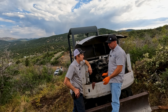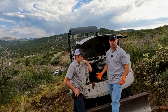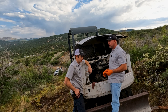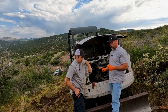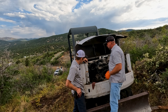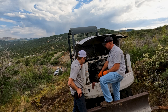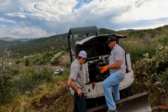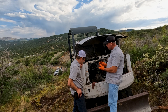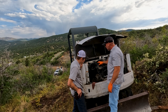The blade is manual cable control where everything else is pilot control. So if a micro switch went bad and you tried to work the blade, it should work regardless because it is manual cable. Based on other videos, we know we probably have a stripped pump coupler. Sometimes what we can do to get it off the mountain is back the pump up and get the internal gear into a better spot in the actual drive coupler so we can drive this down the hill.